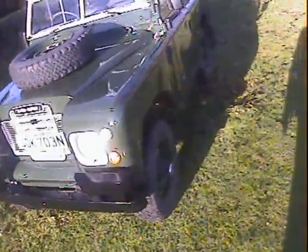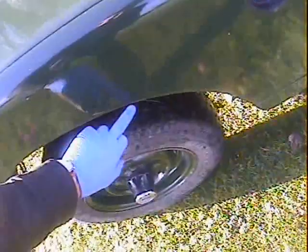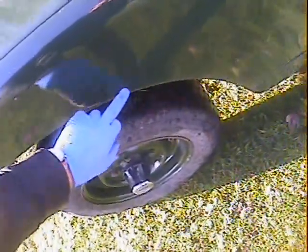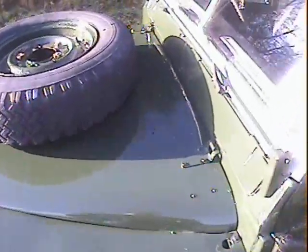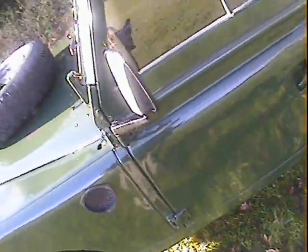Looking down the sides it looks pretty straight — actually looks really nice. There's a slight crack in the paint just along the arch itself, but very slight. The scuttle corner on this side looks very good, just starting to bubble up a little bit on the outside edge — just slight bubbling, but all this looks very nice. The A-post looks good, with just a little bit of bubbling under the paint on the top of the A-post.